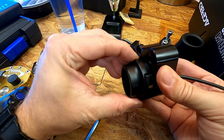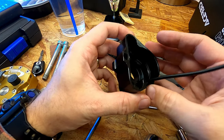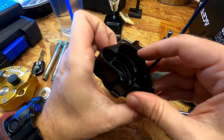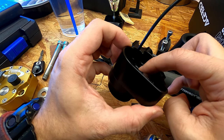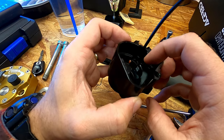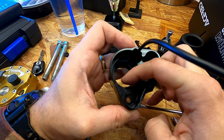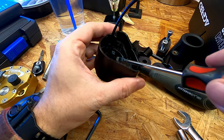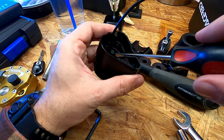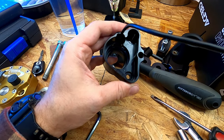It's now mounted and I am pulling and this won't come out. The challenge here is this little gray plastic thing and this little gray plastic thing. Those are like little clips attached to the immobilizer ring, and they were kind of caught on this collar. I used the screwdriver to get behind them with just the littlest bit of twisting pressure. You can see I can just bend that out a little bit.